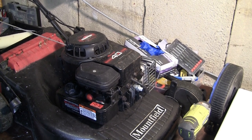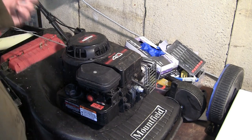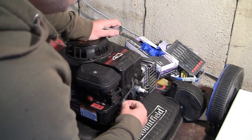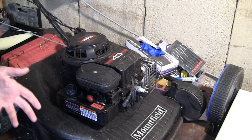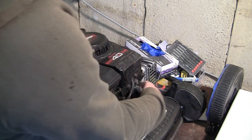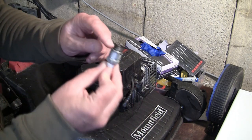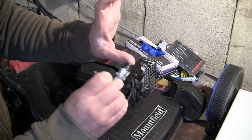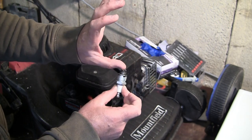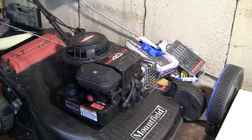Unless you've had a problem with your lawnmower, it's very unlikely you'll have taken any of it apart. You'll only take it apart to get through the summer — make the mower last long enough to cut the grass, fix it cutting out, or sort out the revving up and down. That's totally understandable. So this is the process most people follow to do a basic service. First, take the spark plug out and check there's a gap. Make sure you haven't overtightened it — you can actually bend the electrode so there's no gap, and if there's no gap, you will not get a spark.